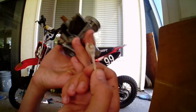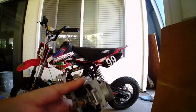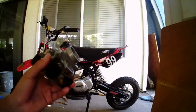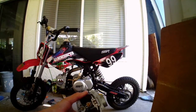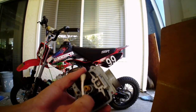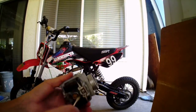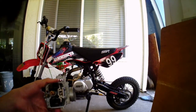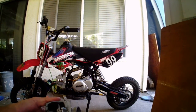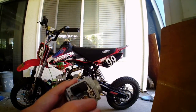You also want to clean out the outside of the carburetor — it's pretty dirty. I just got done cleaning and the cotton swab is not clean at all, but the carburetor is much cleaner now. You don't want to put the carburetor back together dry, so get some gas and a cotton swab and spread it around inside the carburetor. You can also use a spray bottle. I forgot to put my pilot jet back in — good thing I noticed. I screwed my pilot jet in and I don't tighten it that much because I don't want to strip the threads.